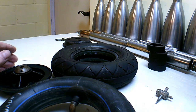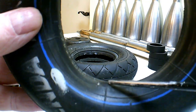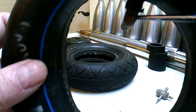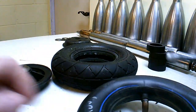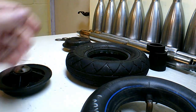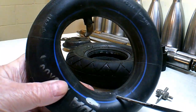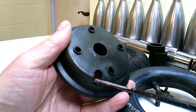After I got it home and took it apart, the reason it went flat was this right here — a little tiny blister. It's almost right opposite the Schrader valve where the air goes into the inner tube. What happened was this rubber extruded, probably because I put too much pressure in it. It says 36 PSI on the tire but I didn't have a tire gauge at the time. It was the first time down in the spring and I just pumped it up until I thought it felt hard enough, but I might have put a whole lot more than 36 PSI in there. The rubber extruded in where the Schrader valve goes.